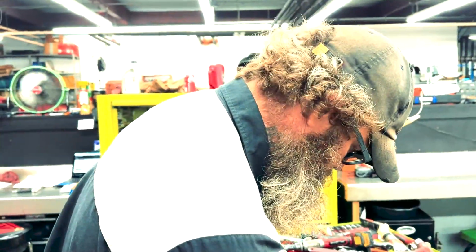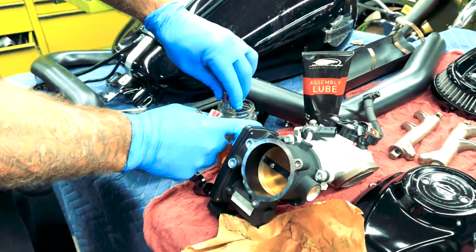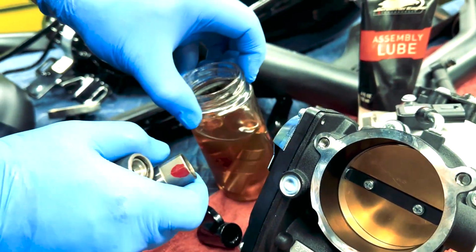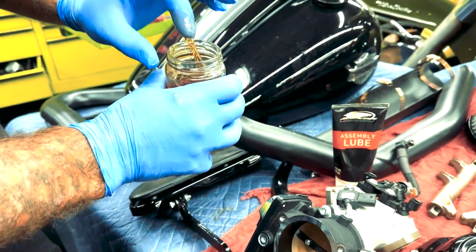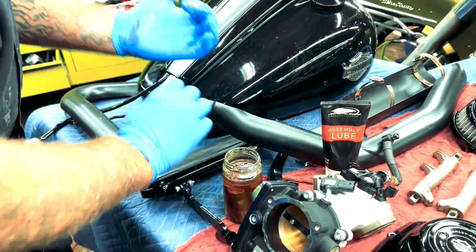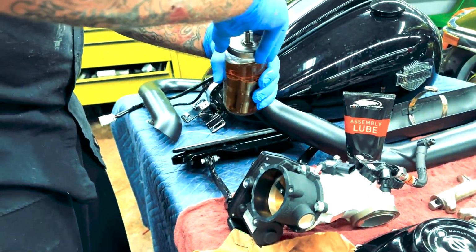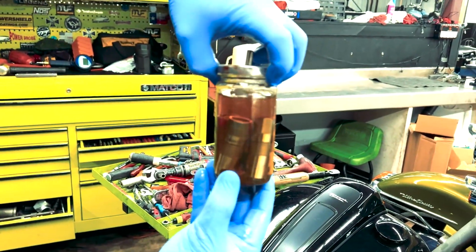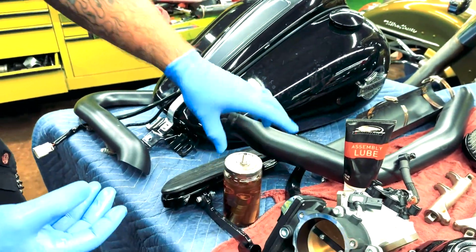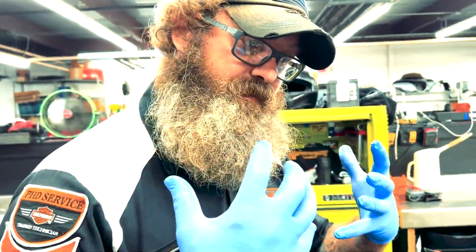What's up, guys? We're gonna work on getting the air out of these lifters. Just set them in here, like so. What we do is we wait until we start seeing the air bubbles come out. We're taking all the air out of that lifter. After a while we'll hook up what's called a Mighty Vac machine, and that'll pull all the rest of the air out.